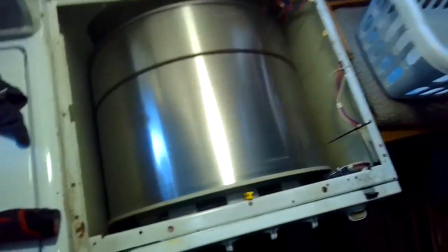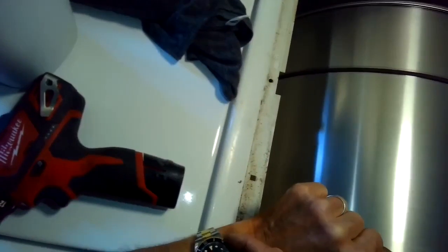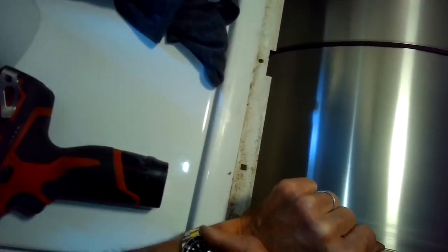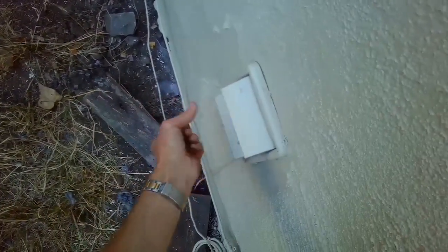Turn it back on — it's spinning really good, nice and smooth, with no more excessive gap. While it's testing, go out and check the volume of air coming out of the vent tube — it should feel like a hairdryer. That's nice and strong, so there's no lint really clogging it. Put the top back down; those two clips just push down to lock. You're all done — you're going to have a dryer that's non-squeaky and won't burn holes in clothes. Might get another ten years out of it! Thanks so much for watching and please subscribe to our channel.